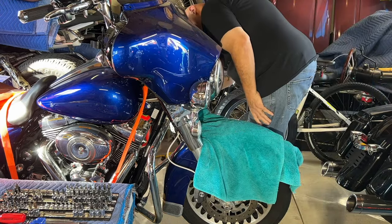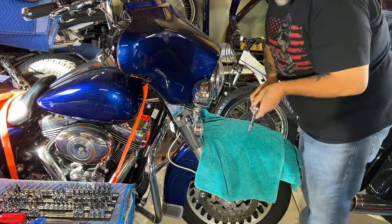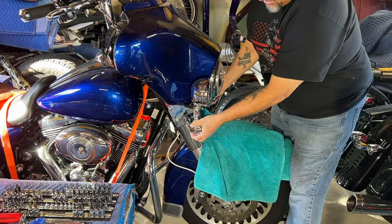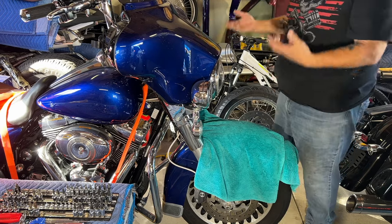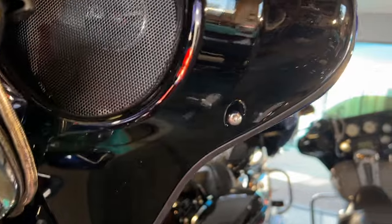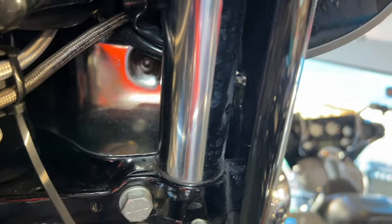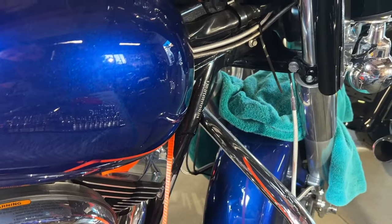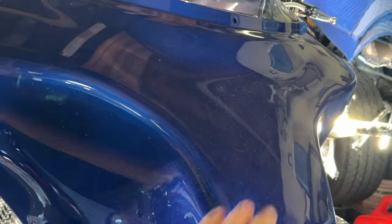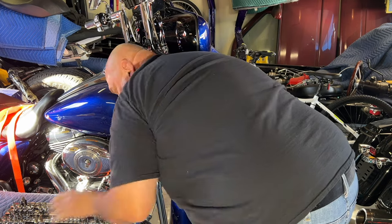I'm taking these two bolts off the top of the forks. The way you can do this is you loosen up the top bolts and the side bolts, and these just lift right off. You have two bolts on the side, two down here — there's one on each side — and these two connect to the bottom of the lower fairing, this chrome piece. You can take that all off as one piece. The three top bolts, two on the sides, two on the bottoms, and the outer fairing comes right off. Those down there on the bottom are three-sixteenths, and they come off pretty easy.